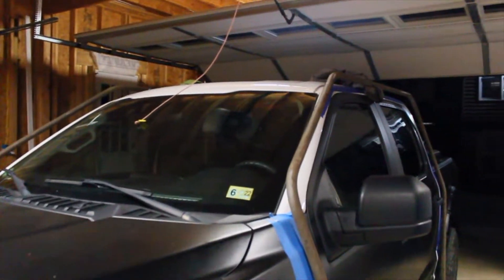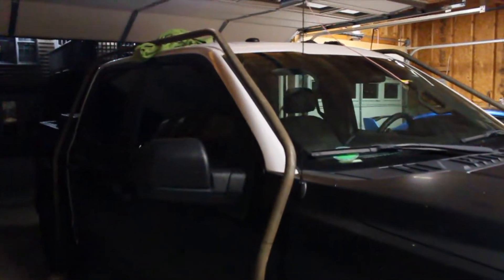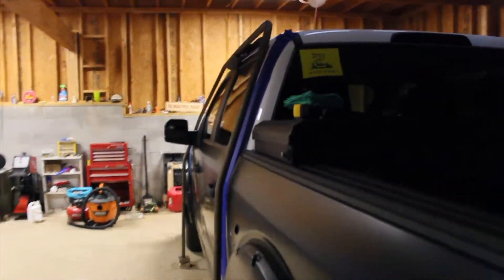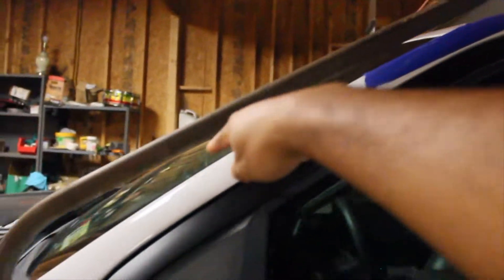Both sides have been bent to shape to follow the truck's body lines as best I could. It's mocked up right now, but it's gonna be hugging the body as close as possible. Here's the other side — we're gonna have a bar to hopefully tie these two pieces together. It's not 100% fitted right now; this one's actually a lot better. See that hugging the cab nice and tight. We've laid down a bunch of painters tape just to protect it from scratching. Now if you're an eagle-eye viewer, you can probably tell this doesn't exactly follow the body line, and that's because our pillar here isn't exactly 100% straight — it starts to curve and then it widens.